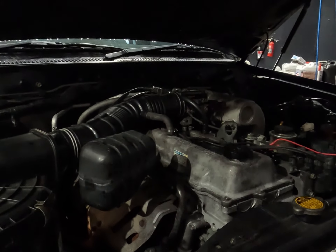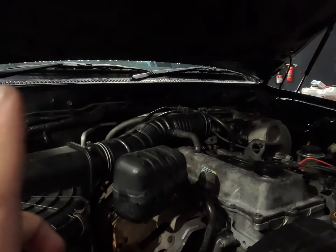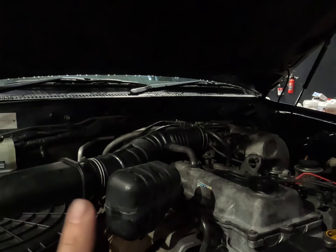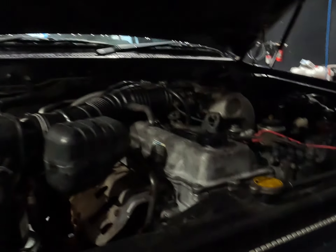It went to another workshop who is our customer to diagnose — lovely bloke. He got us out there to have a brief look because he's just across the road from us. We have an engine mechanical issue; it sounds like crap when it's cranking. I did believe we had a crank sensor issue as well because there's a lot of silicone around the sump.